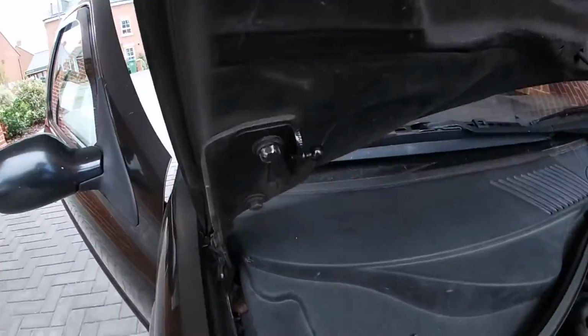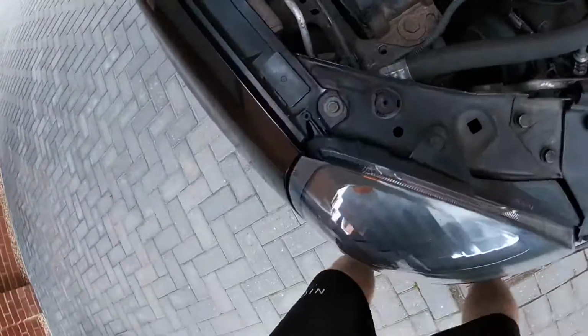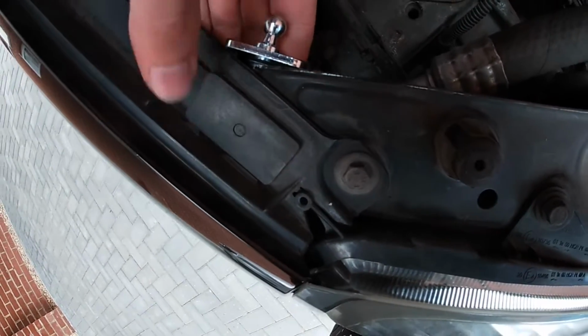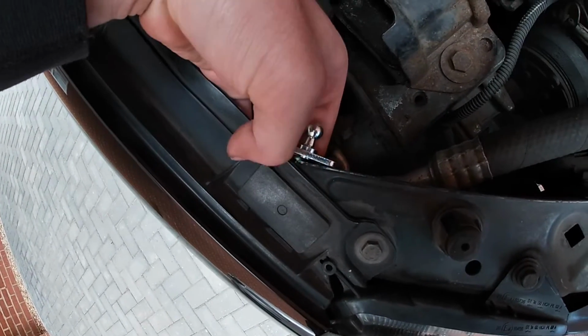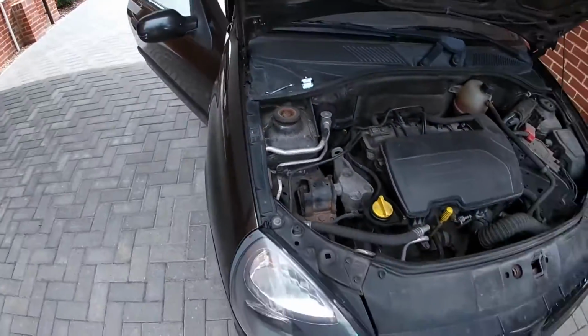It's working, it's working. So just like that bolt, this nut under here was a 10mm, so use a 10mm spanner. Then I believe it's just as simple as it says, putting that on there and then threading it up. It seems to fit all right, so we'll find out. But yeah, just put that under there. There's a little thread to put it on, and then put the nut on top, and it does seem very simple, and I won't lie, it is going ahead quite easily.